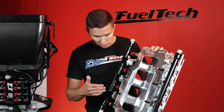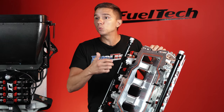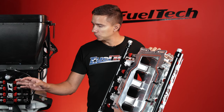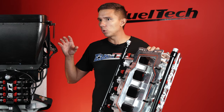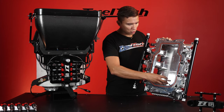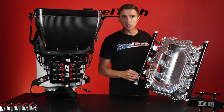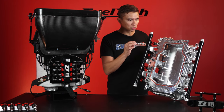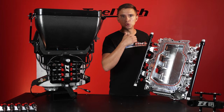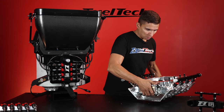This side — the bottom injectors — can do individual fueling. If you need more fuel on the back or more fuel up front, those injectors allow you to do that across the RPM range, boost range, and load range. The top injectors cannot do that. That fuel goes through the blower, gets mixed with air, and is pushed in — but we don't know exactly where across boost and RPM. Those top injectors you mainly don't use on idle. You use them under power, under boost, two-step and above. The bottom injectors run at all times.